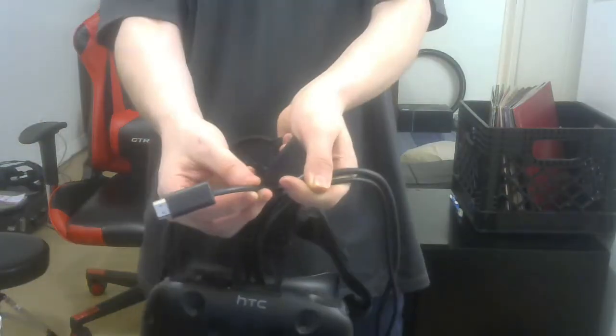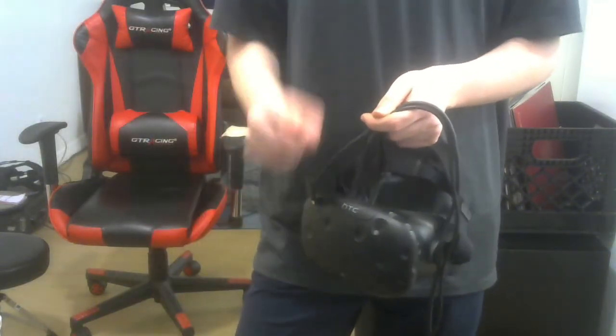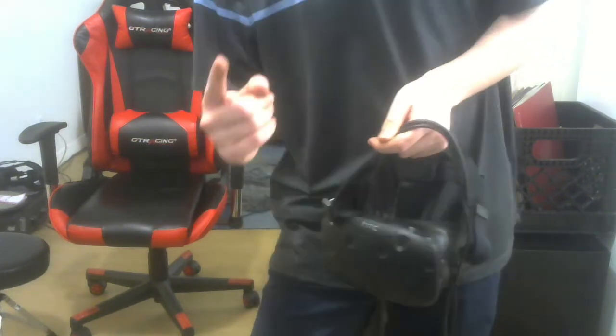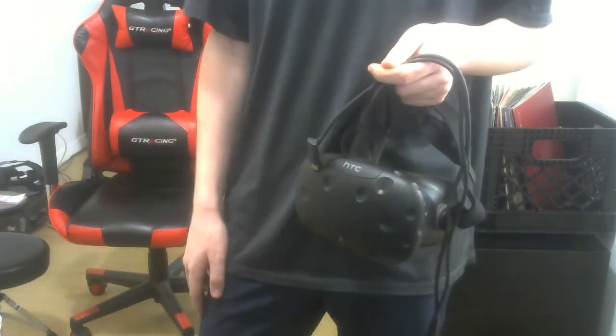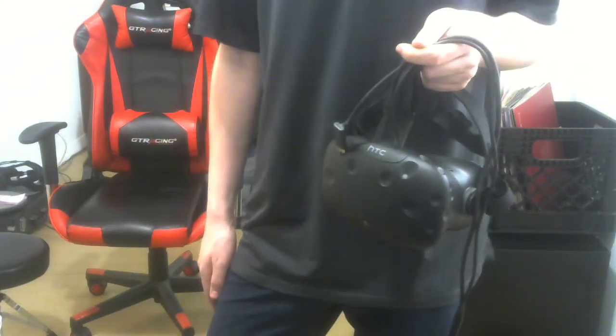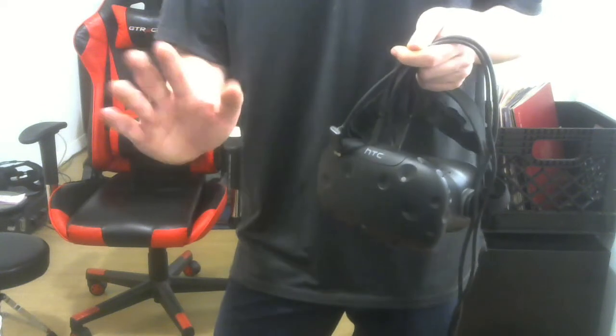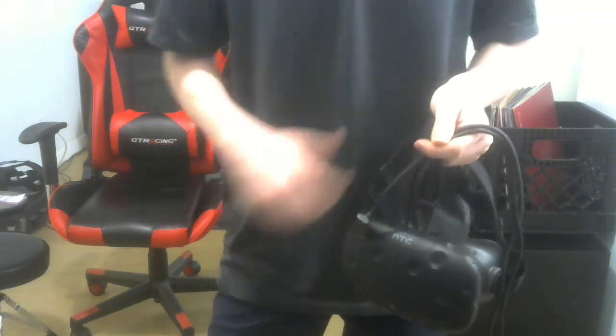Running a separate HDMI cable, cutting off the old HDMI, and zip tying the two cables together is a method I really haven't seen a lot of people using. I myself have tested this method and got one of these jerry-rig cables to last about six months. So for 20 bucks and six months of use, it's a worthy investment instead of buying an entirely new headset. I hope this video was helpful to any of the few Vive users still out there. Leave any questions in the comments and I'll gladly answer them. Don't forget to like and subscribe, and I'll be back at some point in the future. Peace.